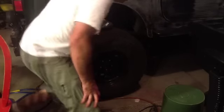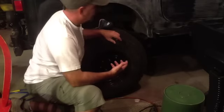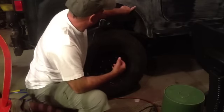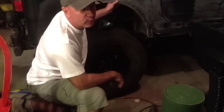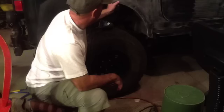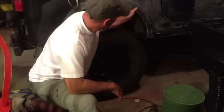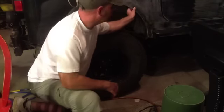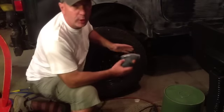Getting the fenders pulled was really quite a bit of a chore and it took both Melissa and I working on it to get it done. We had several screws that simply wouldn't come out. I eventually had to take them off with the cutting wheel and I've been hammering that back out and making it flush. For the first pass, I'm using 200 grit sandpaper.